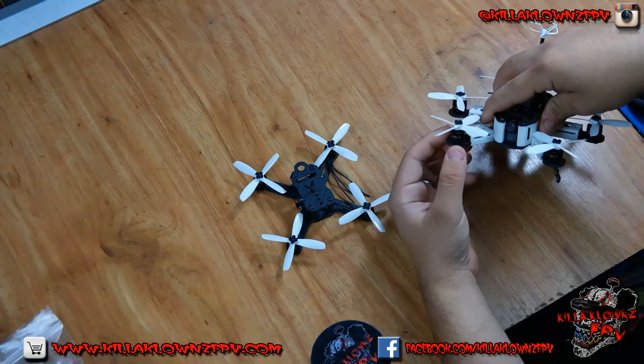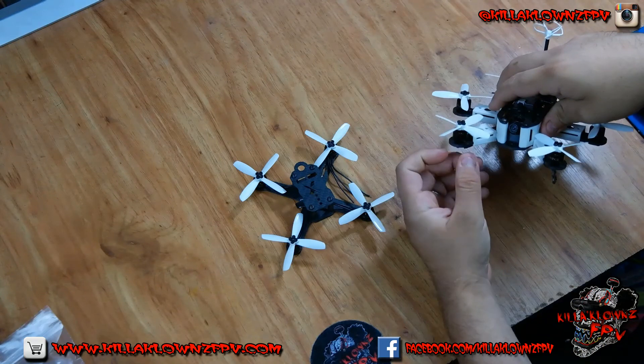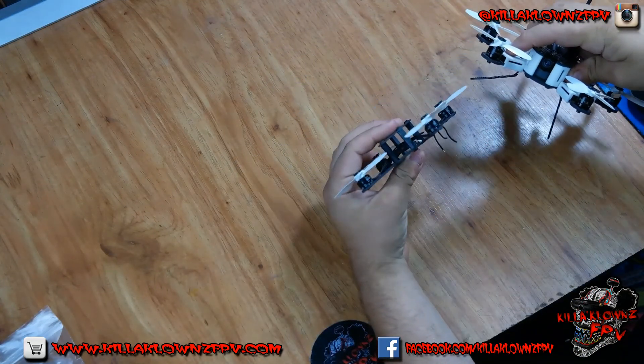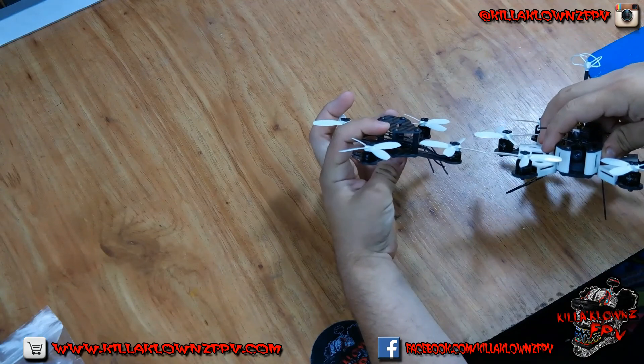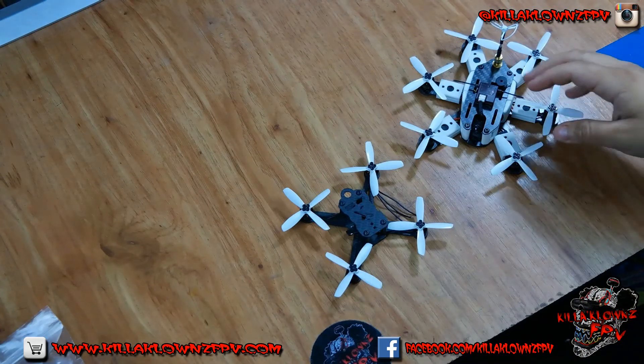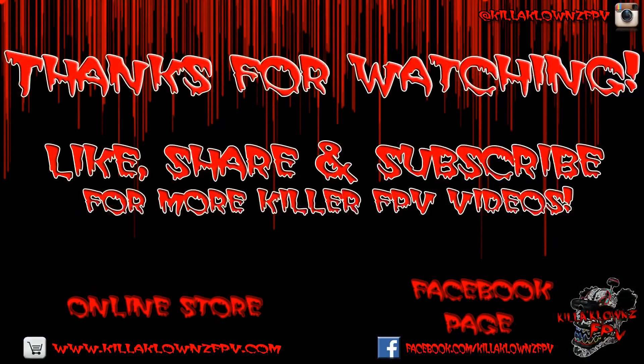That's the first look — and this is after flying them for a couple of weeks now — of the Rotor X 1105B 6500KV and the Rotor X 1102 8500KV motors. 2S or 3S. You can go 2S on the 1105s, but honestly if you can go 3S and you've got a light build, do it. The power's insane — it just feels like 4S straight through the sky. Thanks for watching. See you guys next time.